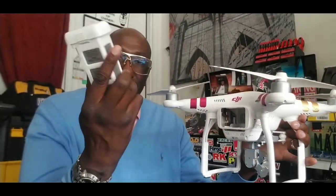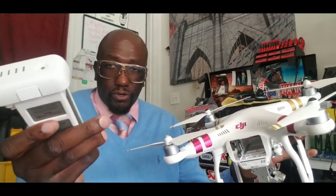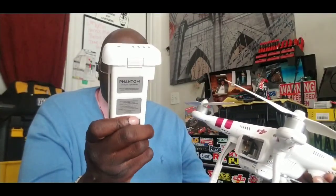This battery plugs right at the back. I'm just kind of telling you the difference between one versus the other — I'm talking to newbie guys. This is the battery for the DJI drone. These batteries are lithium ions, but they're what they call smart batteries — intelligent batteries. They're 15.2 volt and have an actual chip inside that tells the remote and your phone how much battery time you've got left, how much charge, the whole works — just like a battery reader. Don't skim out and get cheap no-name batteries, because they're not going to give you that information.